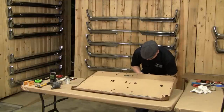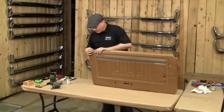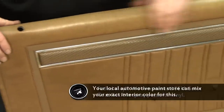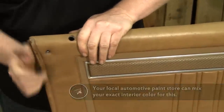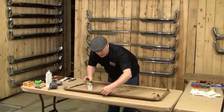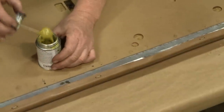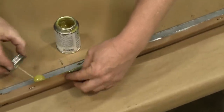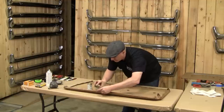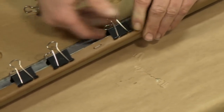We're going to stretch this out, put this back up, smooth it out, and make sure everything's still lining up. The material has shrunk in since it was built and this hole has a little bit of an oblong shape to it — try to pull this back over so that whenever we put the grommet in it completely covers the hole. Next step: where this seam comes up, I'd like to lay a little bit of contact cement in here. That's going to keep this material from pushing back out underneath the beltline strip once it's installed. We'll come back with a set of clips, clamp this down a little bit, let it set overnight — if you don't put the glue here between the staples it's going to try to pooch out, so we really want some glue in there.